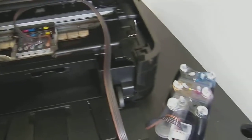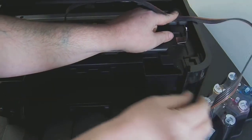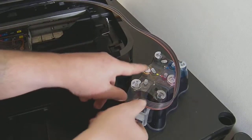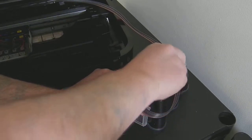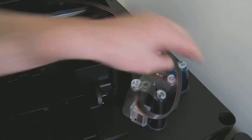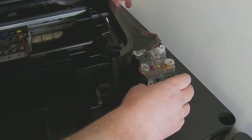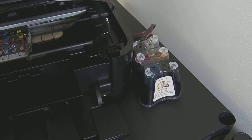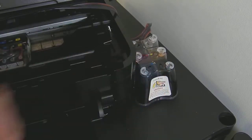Now we're going to power the printer on. Route the cable out over the right hand side. Before you switch the printer on you need to put the roller in the up position and remove the four or five small flat plugs — we'll come back to fit the air filters in a moment. The continuous ink system must be installed level with the base of the printer. It doesn't matter where, as long as it's level with the base. The ink line is long enough to reach around the back if you haven't got the room.